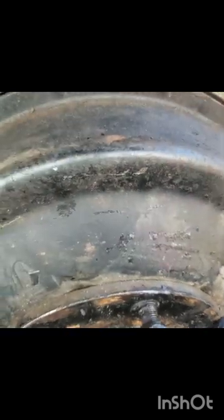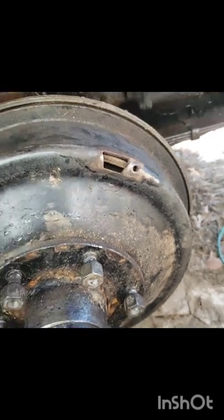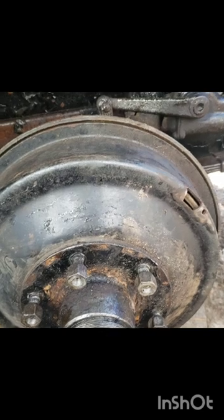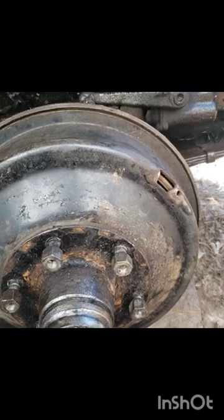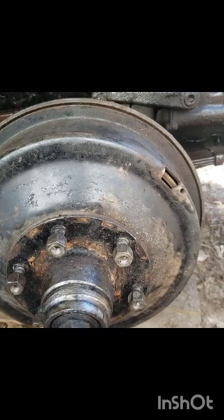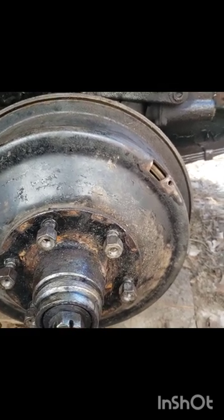I'm going to reach in there with the tool and click this up until I get some tension on the wheel — then the brake should be properly set. I like a little bit of drag, not a lot, just a little easy drag, and then you know your brakes are properly adjusted. Three more to go and that should be it for this part. I might do a part three on the back drums — they're going to be a little different, we'll need a special puller for that. Thank you all for watching — please like, subscribe, and comment. I do have a 1931 Model A hot rod truck I'm working on that'll be featured in upcoming videos, so please stay tuned!